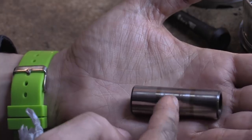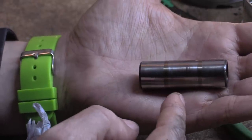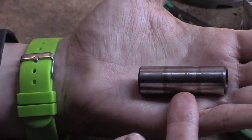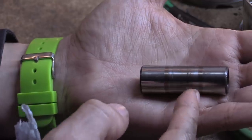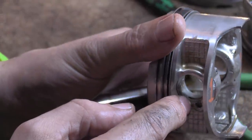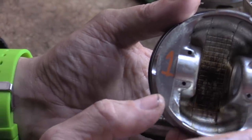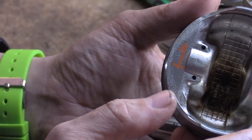These rods are not pressure-fed — they rely on splash lubrication. Splash lubrication means it's not directly pressure-fed like journals on your bearings or camshaft. There are grooves on the sides to aid any oil that's splashing around and squirting in. These don't have oil squirters — or so I thought.